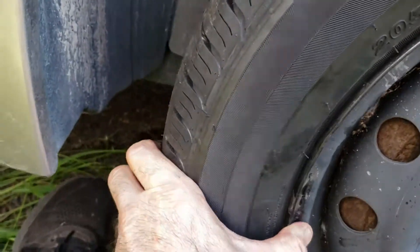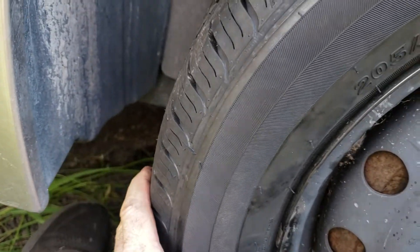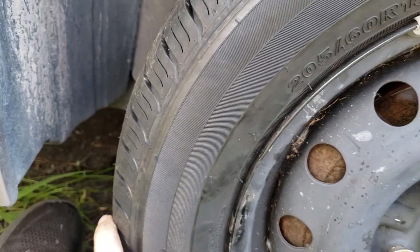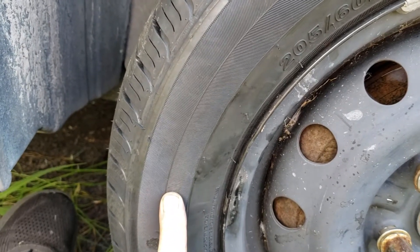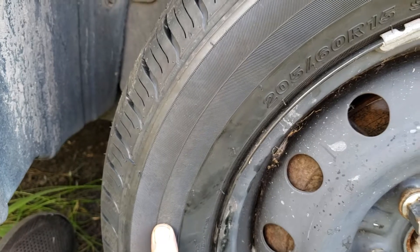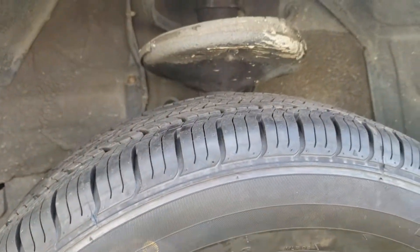As you saw, this one has a bad lower control arm bushing. Now before you just jump and start changing that, make sure your tie rod end is not bad because that can also do the same thing. I've already looked underneath and there is no bushing anymore.